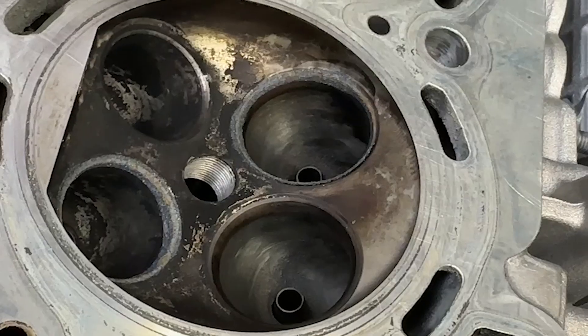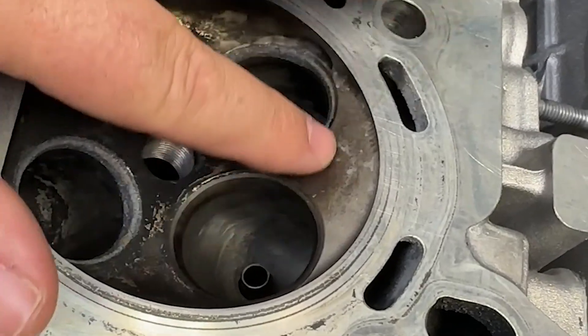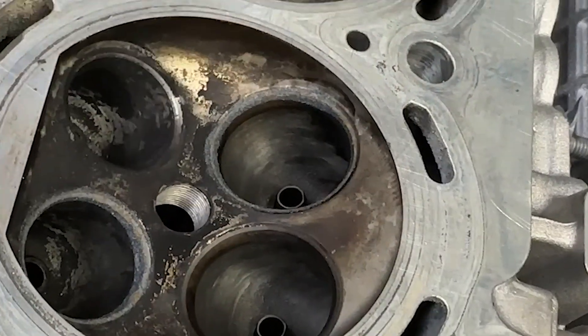Either way you have to weld it, just because the marks will burn into the combustion chamber, which we weld a lot. Some people move to just removing the quench pads on both sides, or they remove the quench pad on just one side — I don't know why. The theories are robust in that arena, and I think part of that actually started in Japan. HKS or somebody started machining them out and everybody was like, oh my gosh, you are the savior.